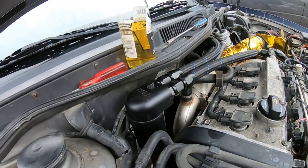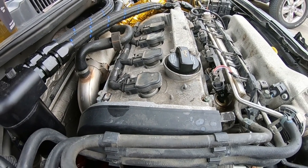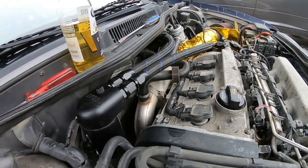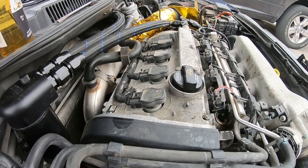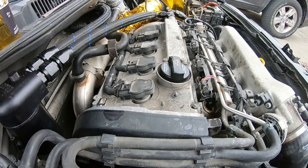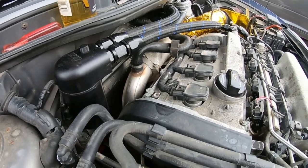So that's the injectors and fuel pump installed. Make sure any fuel that's fallen in the engine bay area is dried up. Then hook up the battery and prime the fuel pump — turn the ignition key to the on position to cycle the pump before doing any starting. Once you get everything going, check for leaks, no matter how big or small. Have your fire extinguisher ready, and if someone is with you, make sure they're aware and ready to react.